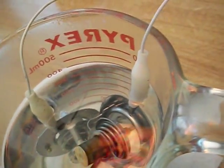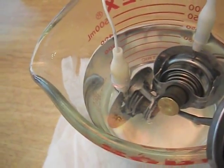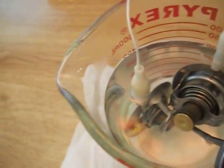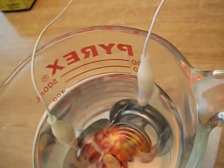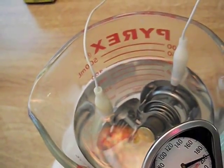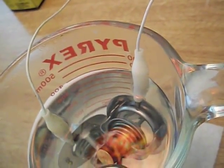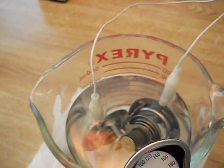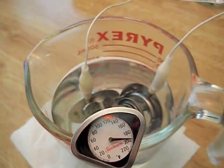I heated it up to boiling, so it's just a little below that now. That poor Stant thermostat — the Nissan is doing everything it can to get out of its own way, look at how far it's retracted, whereas the Stant has opened but just barely — and that's at 200 degrees. If this doesn't tell you to use the Nissan over the Stant, I don't know what does. I even prefer the larger diameter of the Nissan because when it does release it's going to flow more too. That falls under 'nuff said — I'm done with thermostats.